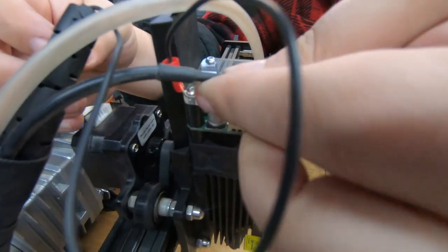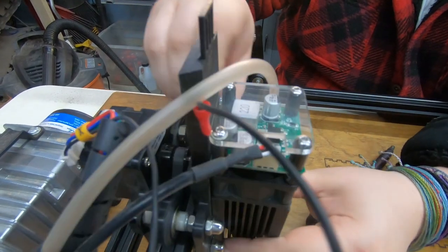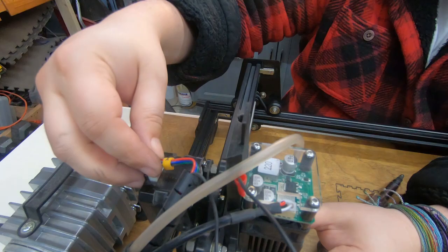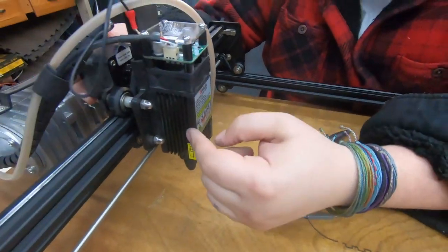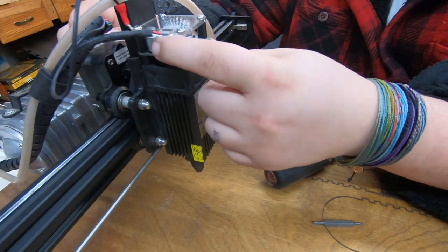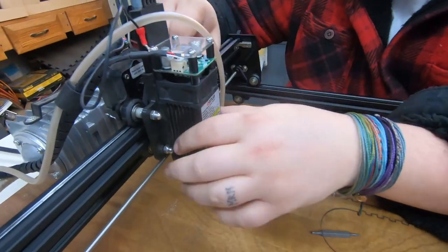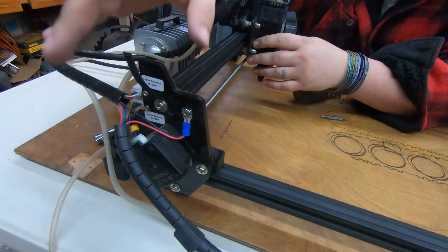Now laser power and motor. If everything works but the laser doesn't fire when you put it back in, it's probably that. So pay attention and get all of your cables tightened back up in all spots — both your motor here as well as your motor out here. Make sure everything is plugged in. Tighten down your acorn nuts.